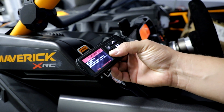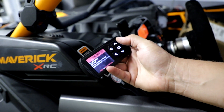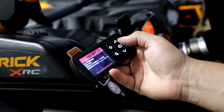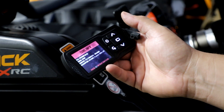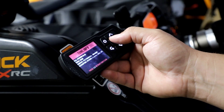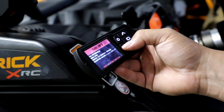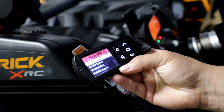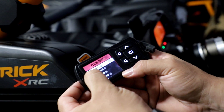Go to flash tune and select the tune you want to run — click on that. This one is on a 250 RR package right now. It'll give you a description and tune compatibility file, and show the tuner who wrote the tune. Then click the center button to start the flash. You can tell which tune you're currently running by the asterisk next to it.